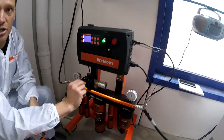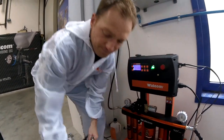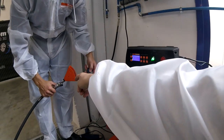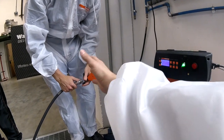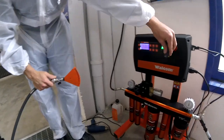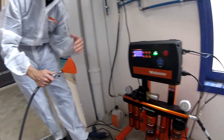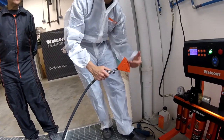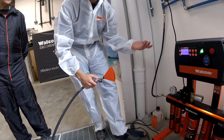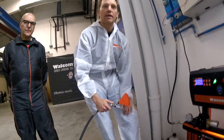In terms of proper temperature application — clean, purified, dry air. For drying, you would set it at 70 Celsius, and that would help with the air expansion so it doesn't go too cold once it hits the panel, therefore drying the paint faster. And even during the paint process itself, having the proper temperature of the compressed air helps better flow, a smoother finish, faster drying time, and proper application. That's why on a nice sunny dry day in summer it's easier to paint than during a humid day or a winter day.